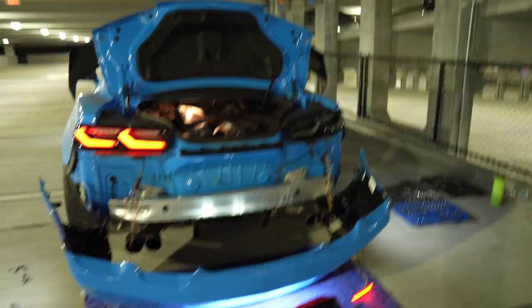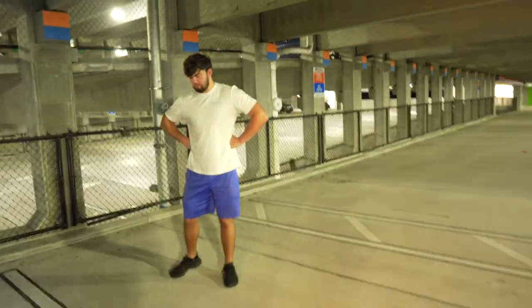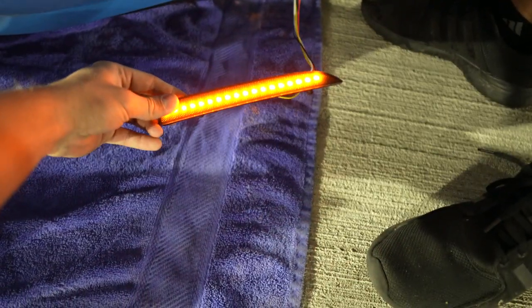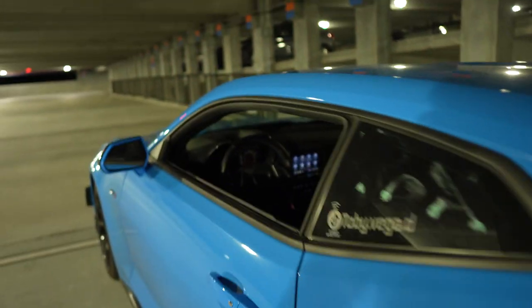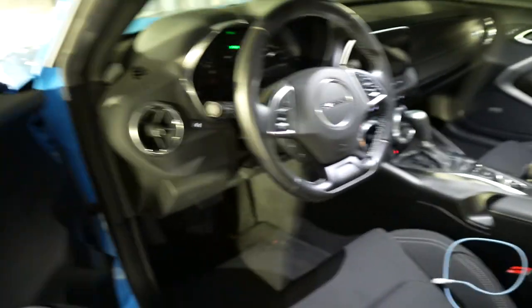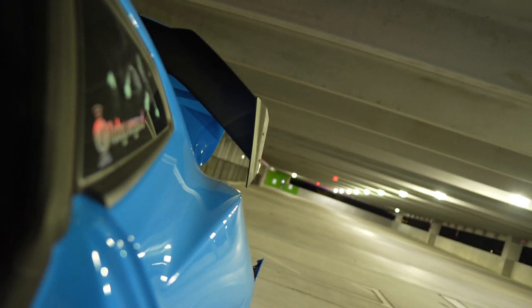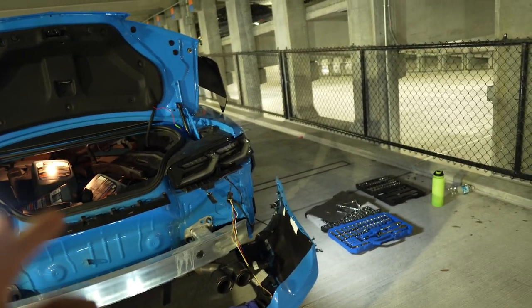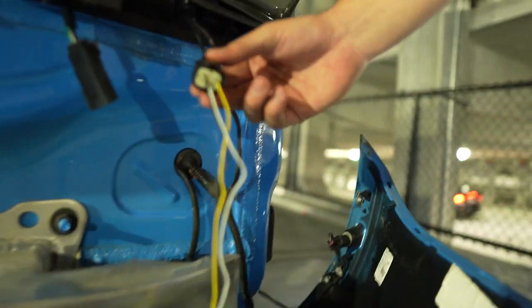Turn signals - let me try. It's not flashing anymore, something else needs to be changed. We switched the yellow with the white - that's the turn signal all hooked up. We have to turn off the turn signal. Look - perfect. Turn it off, see if the DRL works - both DRL and brake. It's still red. The brake is showing up in yellow, so we need to switch some stuff around - the yellow is for the turn signal.